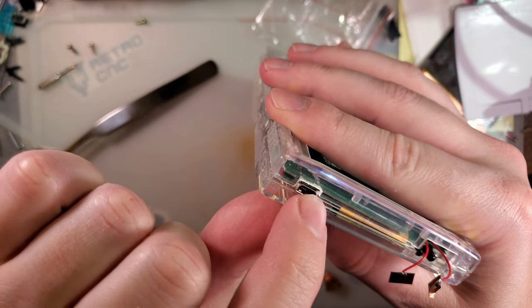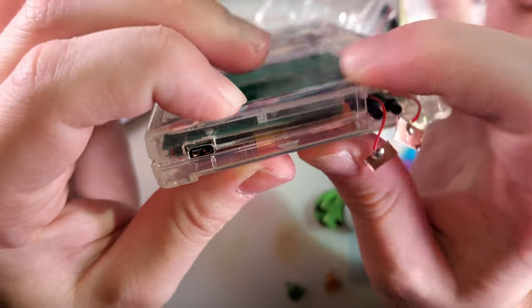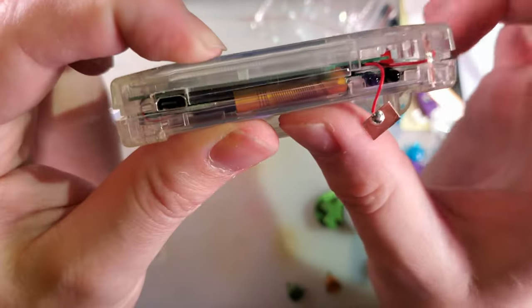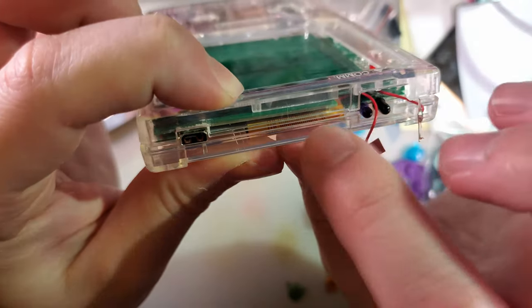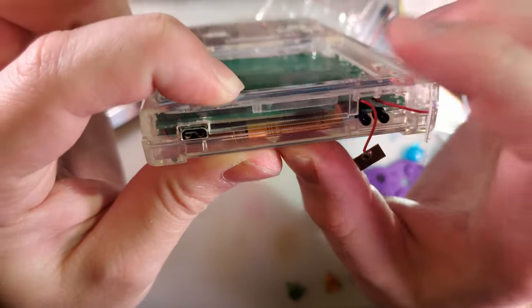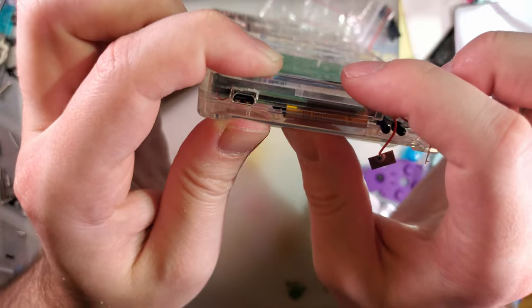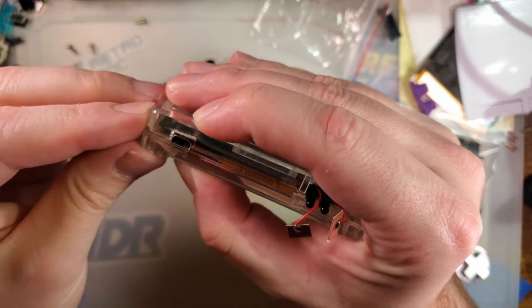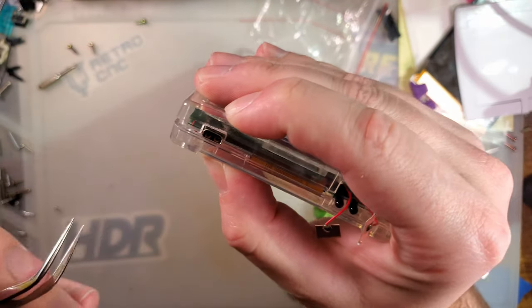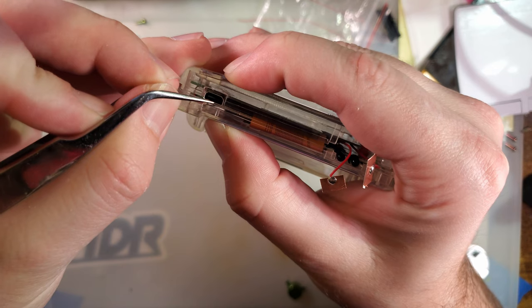And I can file down more of the front shell, but as you can see, the converter board is already resting on one of the remnants for the screen, one of the screen supports. So this side can't go too much further into the shell that way, so we're gonna need to cut that way. And my solution is going to be to mark this up again.